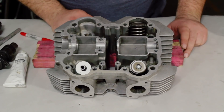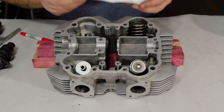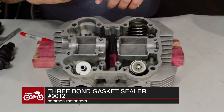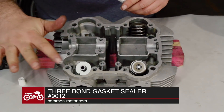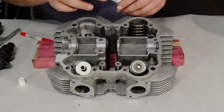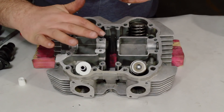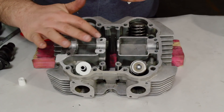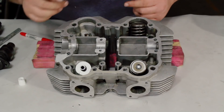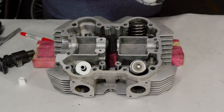There are two ways to prevent this from happening. The first way is probably the easiest — that's what most of you are going to do. Here's our three-bond gasket sealer. When you go to put the valve cover back on, in addition to putting the three-bond around the outside of the head, you're also going to put it right here on those flats, just like that. Then you work your way around, put your valve cover on, drop your cam in, and the valve cover will go on.